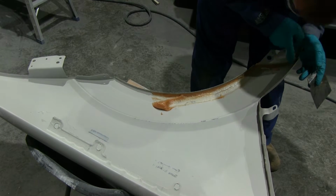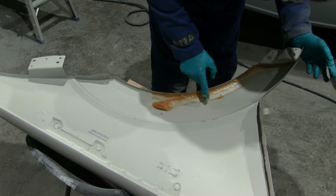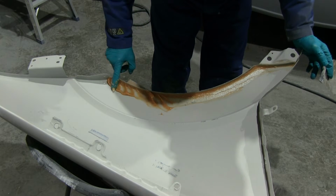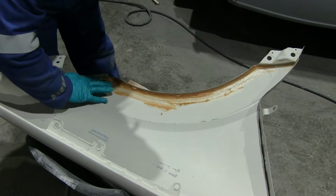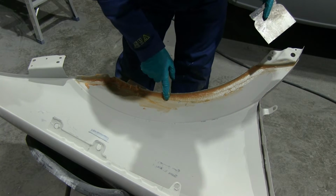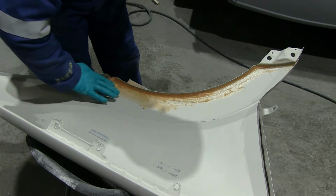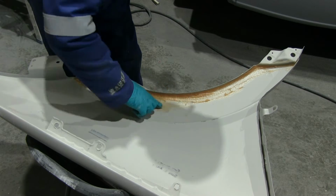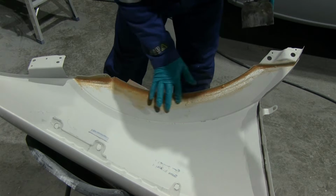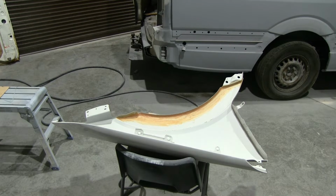This is fiberglass being put onto the lip of the front arches, and this way again, if any dirt goes in there, it will not stick in that very particular place, and it will not hold the moisture, because they are the first areas that start to rust in any vehicle. If you see anything rusty, it's always wheel arches and so on. Considering it's all been shot blasted, coated with zinc and sealed with primer over the top, once it's dried up I'm putting this fiberglass resin on it.